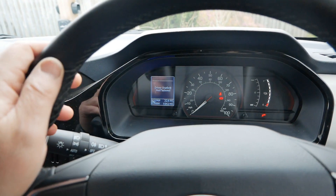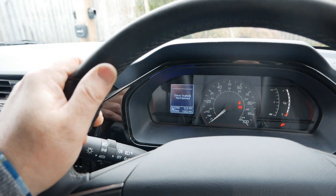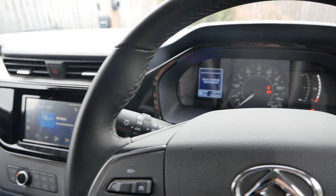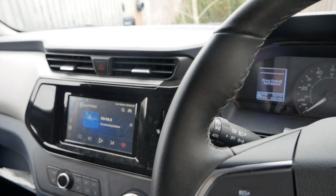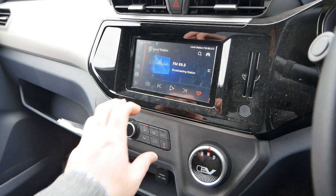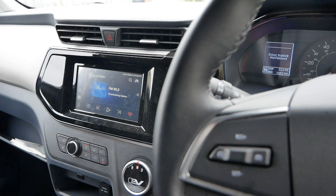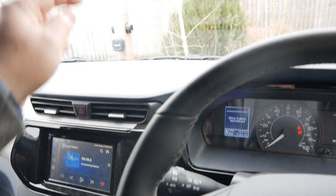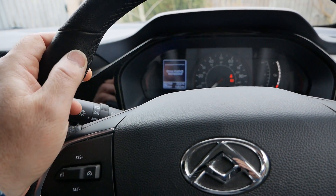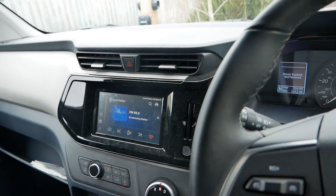In this scenario, when the green light's not on, you'd assume you're just sitting here with the 12-volt battery engaged, consuming 12-volt power — like the first ignition position in a normal vehicle. My heated seat is on and getting warm, so things are working. However, it's quite clear the traction battery is engaged, because if I put the heater on, that is now running — and the heater is pretty sure high voltage, not 12-volt — and it is now producing heat. But of course we're not drawing power from the house; the charger over there is still switched off.